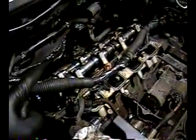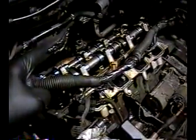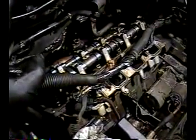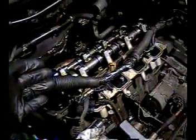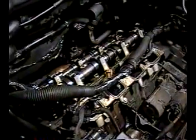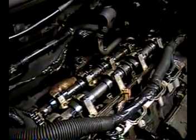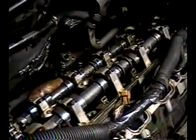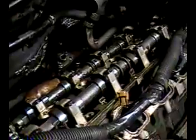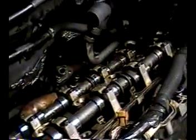There really is no way to access the exhaust manifold bolts for the rear head. You just cannot get to them. You can't get your hands on them. Maybe you can get the top ones off, but not the ones on the bottom. For that reason, I really felt like I hit a roadblock until I did some research on the internet, and the people that have done this before have said you don't remove the rear exhaust manifold right away. You take the rear head out with the exhaust manifold attached, and then you disconnect it when it's out of the car. So that makes sense.